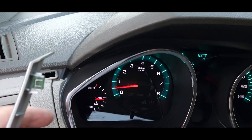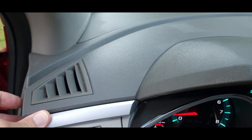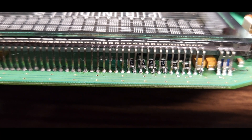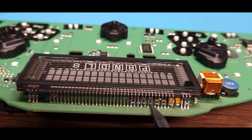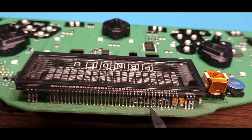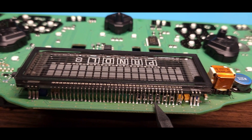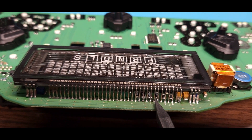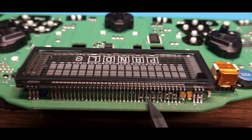After the fact, if you look between these terminal bars right here, you can see one, two, three, four resistors and they have that 622 marking on them. These are the resistors that you can actually look through from this side. If you've got really good eyes you can see it with your bare eye, but if not you need to put a magnifying glass on it or blow it up with your camera. You'll be able to see stress fractures and kind of dry-looking solder, and that indicates that is the actual problem.